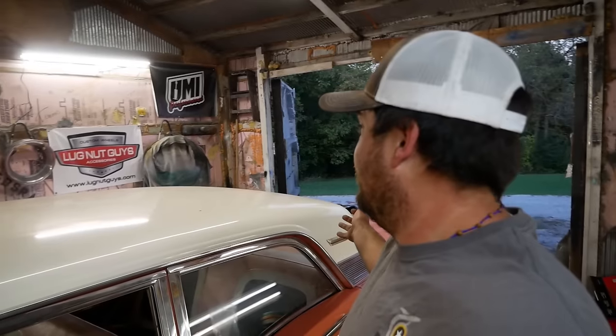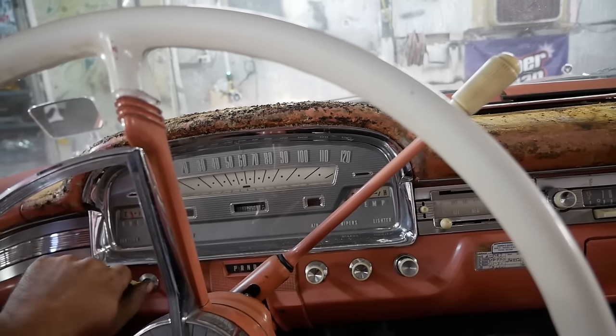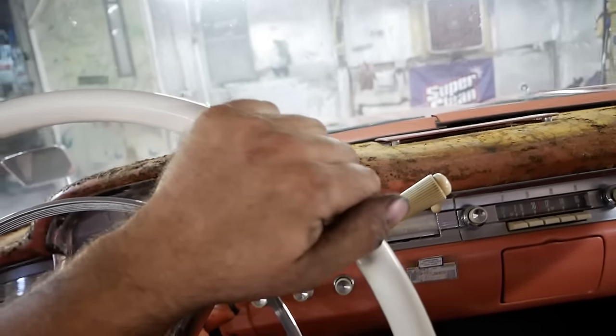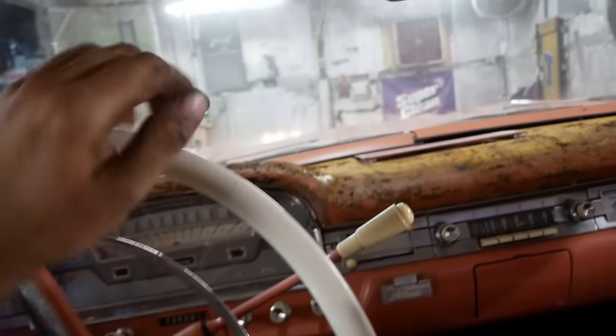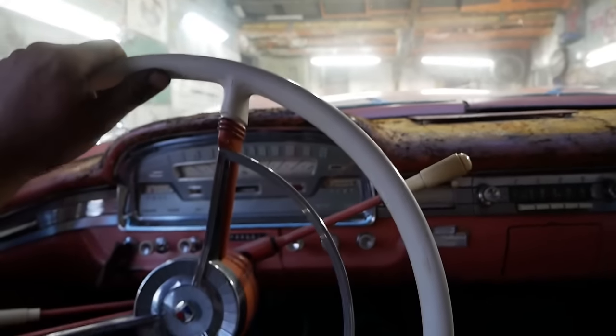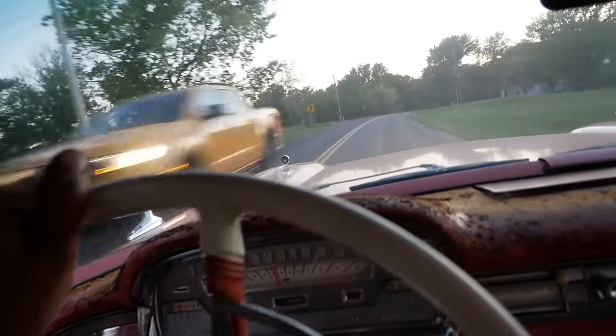At least it runs good. Brights work. Oh God, the brakes are so much better. I think we fixed it — oh yeah. The wobble's pretty much gone, though the wheels need balance. The brakes work — we fixed it! That's not perfect; it needs an alignment and the tires balanced. But the car is drivable now and I would say relatively safe since the brakes seem to work. I guess it was just those wheel cylinders the whole time. You guys who work on cars know how this stuff goes — it's always something like that.